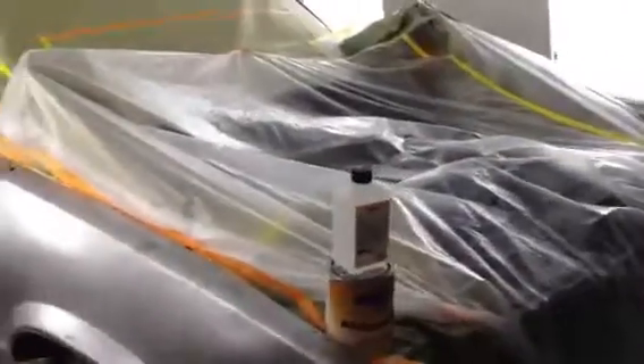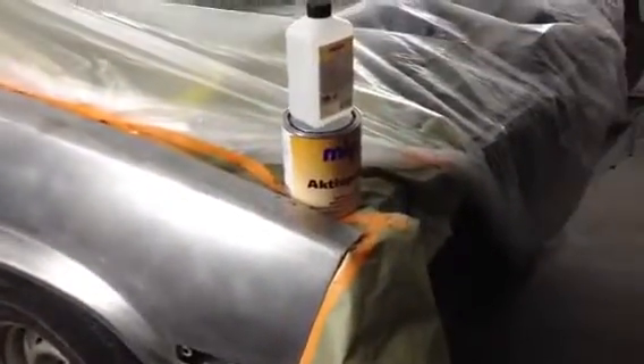Label it — it's got the yellow tape around it. We write where it came from and what it's for. These are pieces. Over here is the El Camino — this is what I'm going to be laying on it right now. It's down to bare metal. That stuff right there — etching primer is what it's called. It's so we can seal it in and protect the metal.